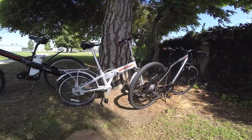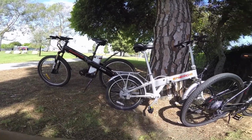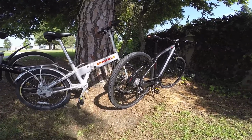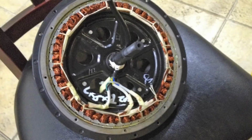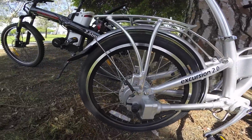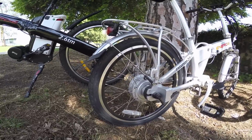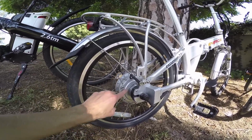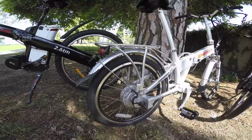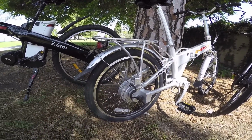So there's a variety of motor types out there, but the basic idea is that inside all of these, there is a gearless motor. Okay, now I know that sounds weird because I just called that a gearless motor. The difference is this is a big gearless motor. The one that's in here is super small. It's right in the middle, and it spins a lot faster, and in order to produce torque, you step down that speed using 3 planetary gears. By doing that, they're able to use fewer magnets. It's able to be a smaller, lighter weight motor, but still give you a good power output.